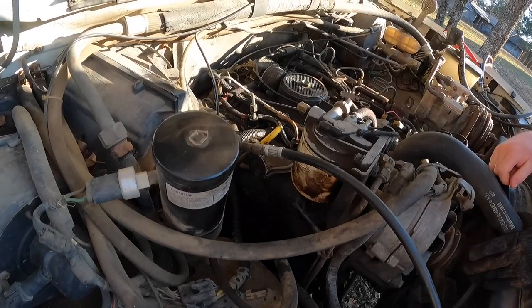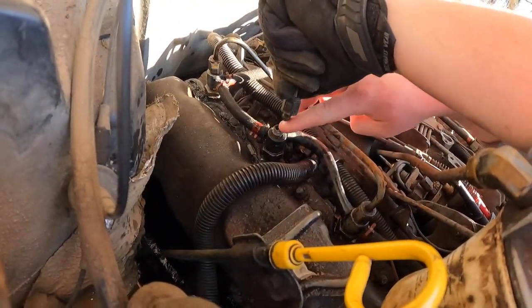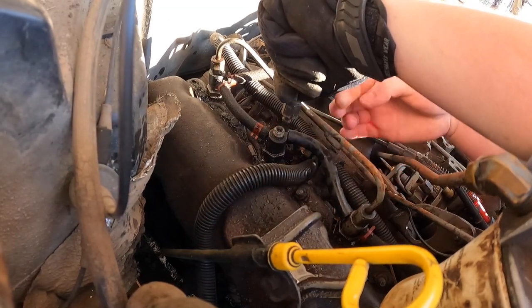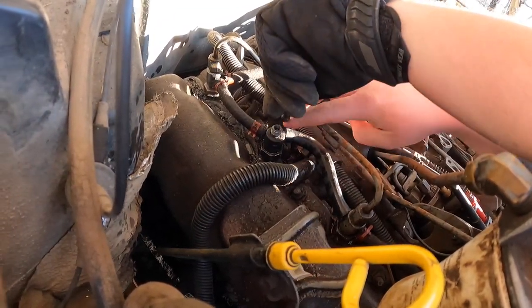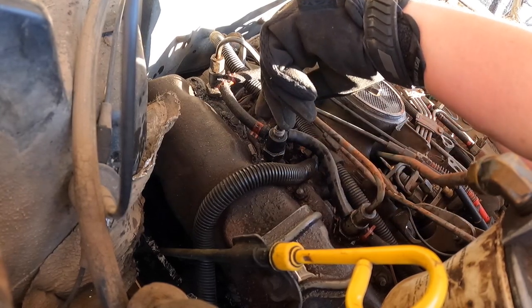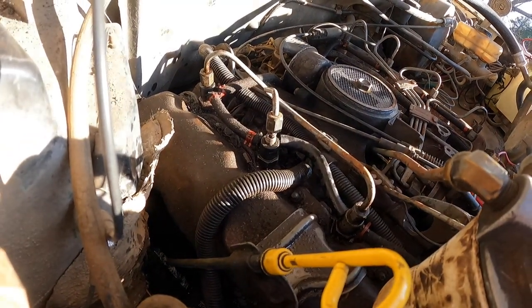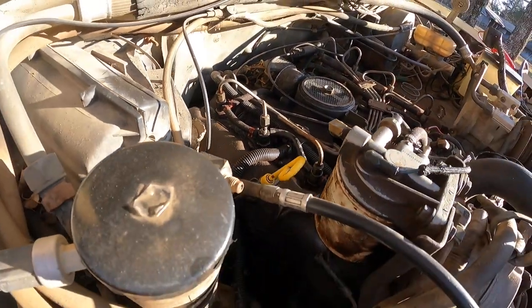Okay, so we decided to pull the line off an injector and see what's going on here. Is there just a bunch of goop in there? Yeah, it's kind of gritty. That leaves dark goo on the finger. All right, well, let's see if we're getting fuel squirting under that line. I'll stand here. You go in and crank it.